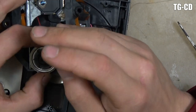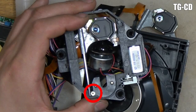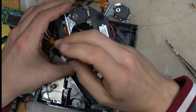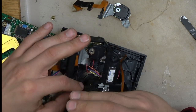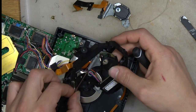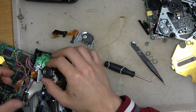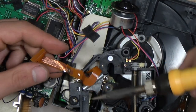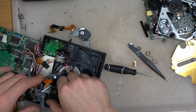There's one more important thing on the laser assembly. Now that the motor is out we have access to this screw — take that out and the laser comes out. On the ribbon cable for the TurboGrafx CD there is a grounding strip. In the video I desolder it, but what you actually need to do is just peel it off — it's a sticker. Peel the grounding strip off the TurboGrafx CD laser and use its stickiness to reapply it to the new Discman laser in the exact same spot. That's all you need to do — very important step.